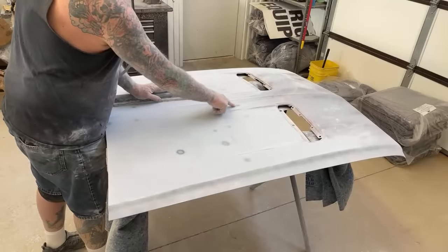I'm going to go over these - it's going to take me a while. I'll have to refill this center up one more time. Then over here we had those imperfections - I'll just continue to block sand them out using a block, not using my hand. You can see them disappearing as I'm sanding. You can still see that there's a low spot here because we've got bare metal here - that's telling me there's still a low spot. That's basically how you do what I just explained to you.